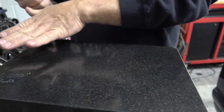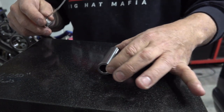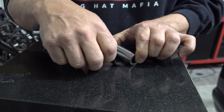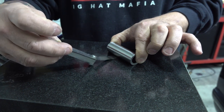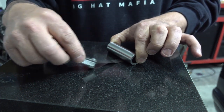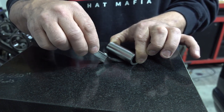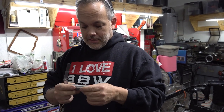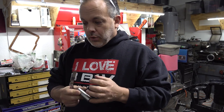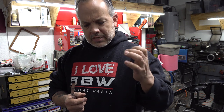Just to rule out the other surface plate being imperfect — it is a lower grade plate and the tolerance of flatness is probably a lot higher than on this one. We're going to set the wrist pin up there and check it the same way. I'm holding that wrist pin tight down against that surface plate and that thing slides under there like it's nobody's business. That is bad news — this wrist pin and piston can probably not be trusted anymore.